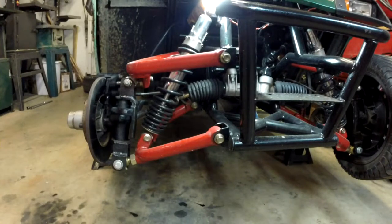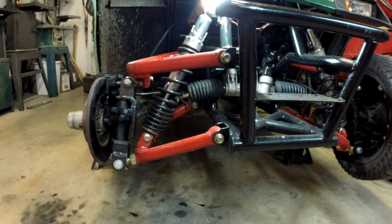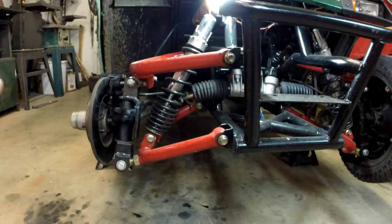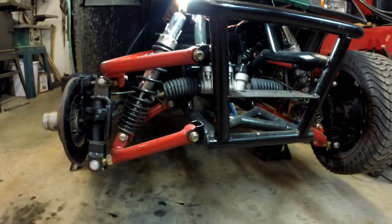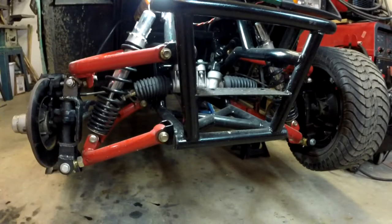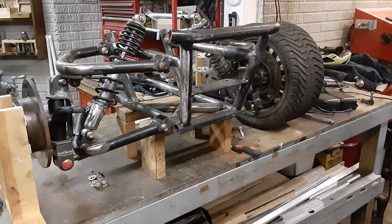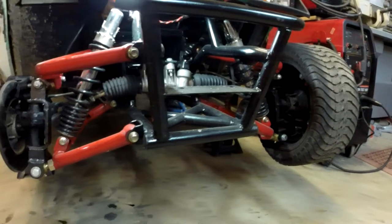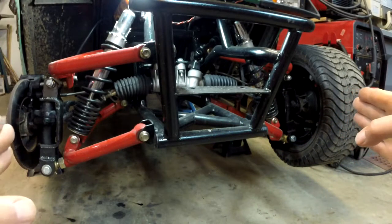When I started designing the suspension, I had these suspension arms from that off-road buggy, but the front track width of that buggy was very wide — like another foot wider than the EasyGo. So I had to narrow it up a good bit. The way I did that was to mock up the whole front end assembly on my workbench. I made a mount for the spindle and another mount on the other side, which gave me my overall width. From there I built inward.